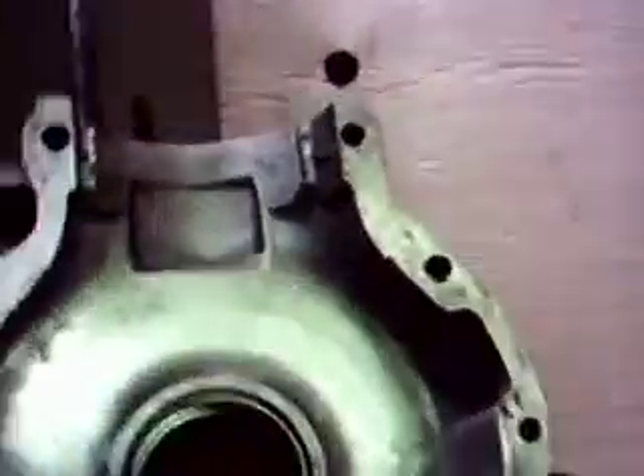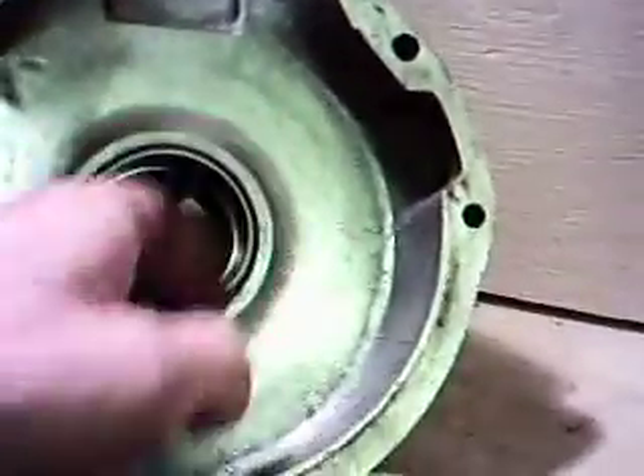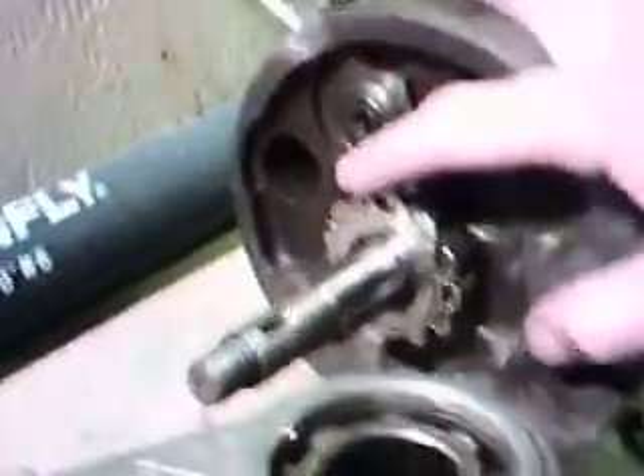Left hand side case here, and this seat is really good, and this bearing — this is the $65 crankshaft assembly, very little play back and forth. Looks like it was just rebuilt for that Westlake head engine they were selling. This fits beautifully in the drive side — the bearing shell fits perfectly.